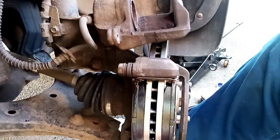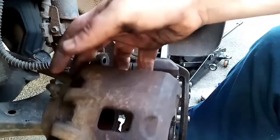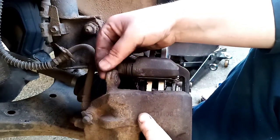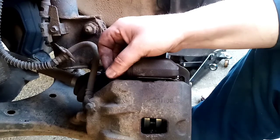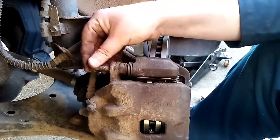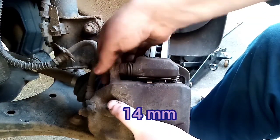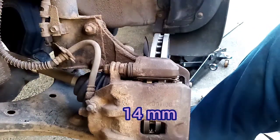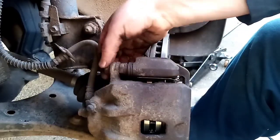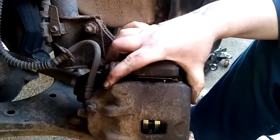Make sure your hands are clean. You don't want to stretch the brake hose. Put the caliper on like that and you should just be able to slide it down. You might have to push the sliders in a little bit first, then put that on. Make sure it free-slides — which it does.